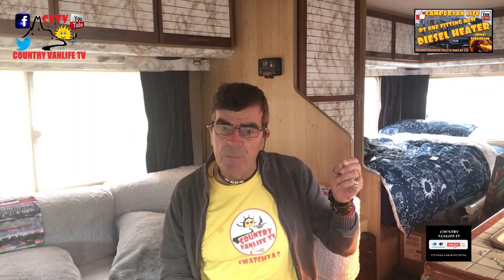I'm going to leave it in, even though I'm not going to use it. I'm going to unplug the gas supply to it, isolate the gas supply, isolate the 12 volt supply from it. So if somebody wants to repair it in the future, they can get it serviced and work it. So I'm going to leave that there. So the Chinese heater won't be going there.